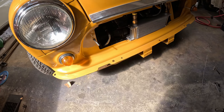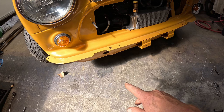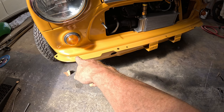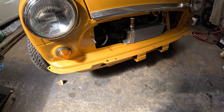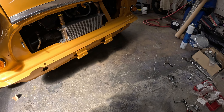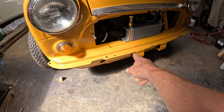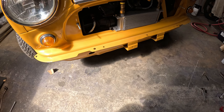So what have I done on the front? I've polished this part, given it a good clean top and bottom, and then I have sprayed this top part — and underneath, on the front and the back — with the Dynax UC, which is the clear one. Obviously, once the bumper goes on, I'll never be able to get access to that, so I'm just covering all bases.